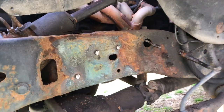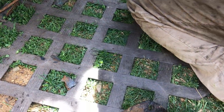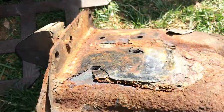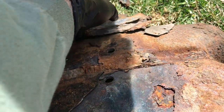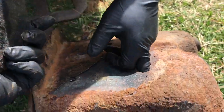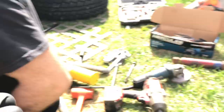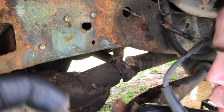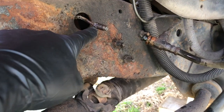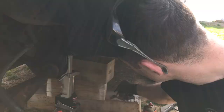The spring tower is off and man, this thing is like chips and salsa bad — it's just cracking. Look at that — straight through. We're happy to see that one go to the scrap heap. Now your brake line went through this, so you'll go to the back side and unscrew it. This will still be in place and you've got to pull that clip.